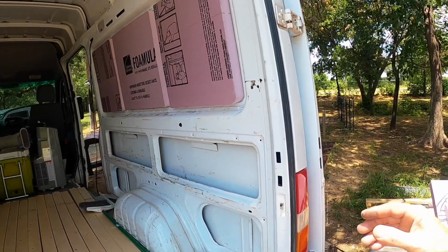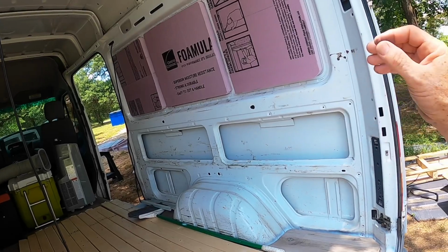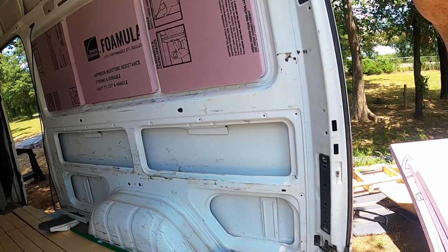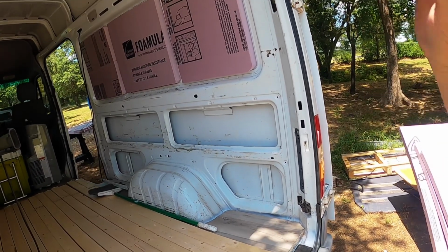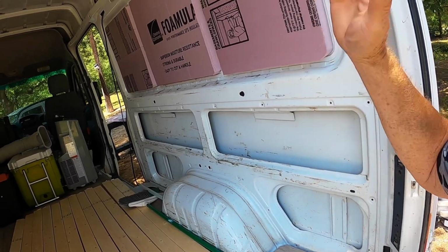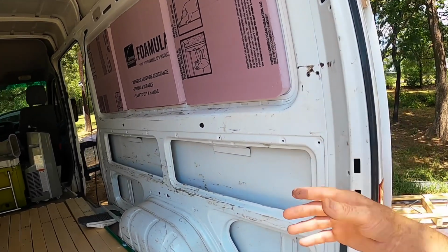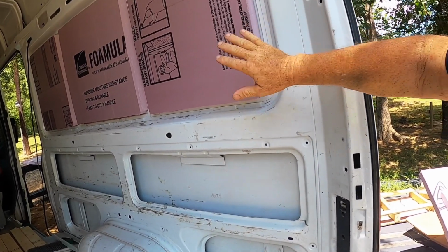Well, on foam insulation, you can do that, or you can do something like, I used to be a mechanic, and to get gaskets and things like that to hold, and interior and headliner, you use a foam spray. It's a spray that's made for foam. You just got to get one that will not ruin the foam. You spray the wall, then you spray one side of the foam that you want to stick to it. You let it set for 2.5 to 3 minutes, as per directions on this particular product. Then you stick it in place, make sure it's good, and press it in.